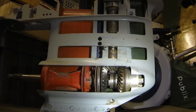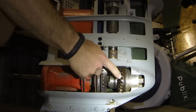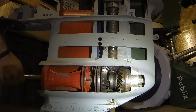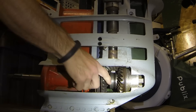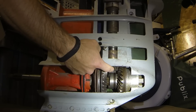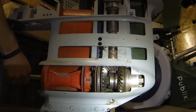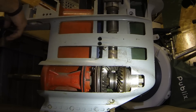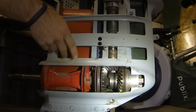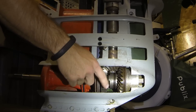When the dog is in forward gear and the drive shaft is rotating, you can see the dog is engaged with the forward ring gear at a one-to-one ratio, so the prop shaft turns one-to-one with the dog and forward ring gear. There is a gear reduction here because our pinion is so much smaller than the ring gears — the propeller is only turning once for maybe every two or three revolutions of the engine.